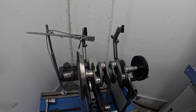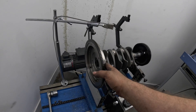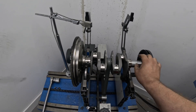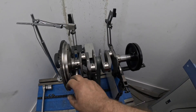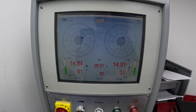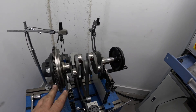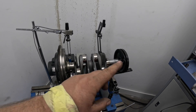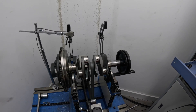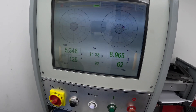So this is the second crankshaft assembly for Brian, which is a billet stroke crank, a really nice front pulley, and another brand new flywheel. I've already balanced the crank - that needed a very slight adjustment just there. Now I'm doing the front pulley and the flywheel and it's ever so slightly out. So I'm going to bring them two bits down and then we'll do the clutch as well. So that's that one completely in balance. What I'm going to do now is balance Brian's own personal bits, which is his front pulley and his flywheel and clutch. I'm going to leave this crank on because the bits will bolt to that and that bit's in balance - I'll use that as a mandrel for balancing his parts. That's that done.